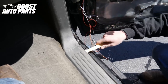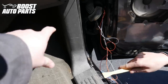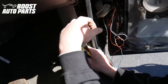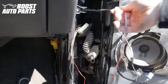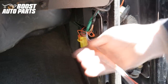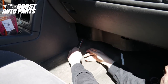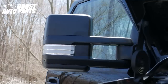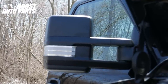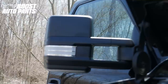We need to remove a trim piece — first we're going to get this top piece off of it. You don't have to remove the whole piece, just the front clip here. Then we're actually going to need to remove this one — it's some trim clips, just go ahead and remove that. Let's go ahead and pass the wires into the cab of the truck and grab on the other side. You're just going to want to fish the passenger side over to the driver's side. There are many different ways to do this — just do it whatever way works best for you. You can use some zip ties and tie everything up. Now you have two options for wiring: you can either run both sides to the underhood fuse box, or you can run the passenger side to the driver's side kick panel and splice the passenger side to the driver's side, then run the driver's side orange and white wires up. It is your choice.